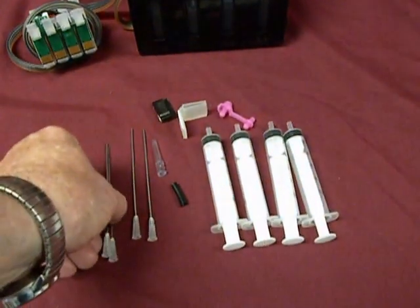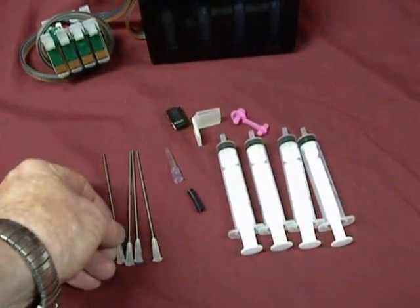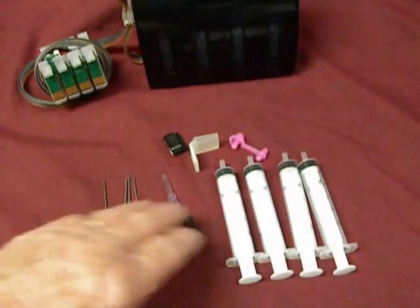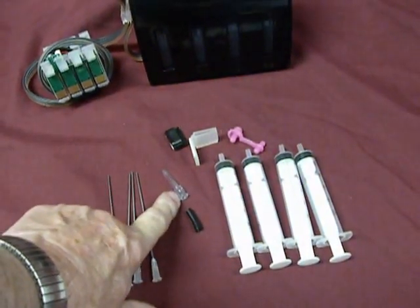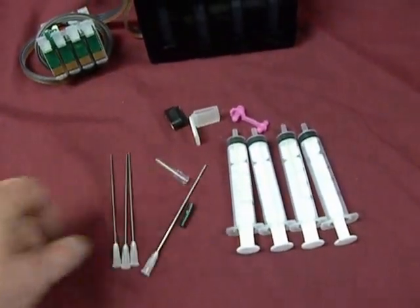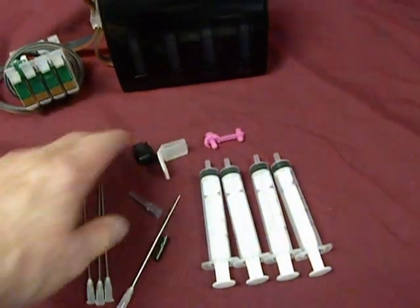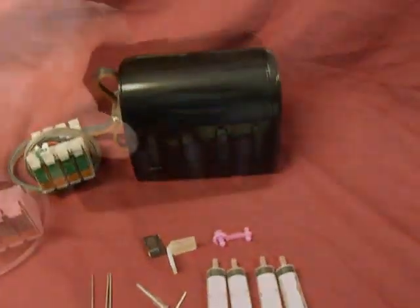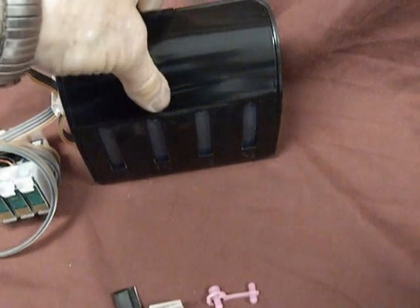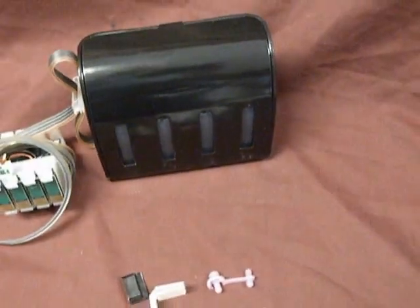Now I'm doing a printhead cleaning. Let me point out the parts and pieces that you get with the Executive Series 3: you get these long tips that go on a syringe, which makes it easier to fill the ink tank. You get the purging tool for the cartridges should you have to purge if you ran out of ink. This little piece of hose is used to prime up the printhead. You need to rock those bottles before installing the continuous ink system — that's going to take all the ink in the isobaric chamber and bring it up to the front ink supply chamber.